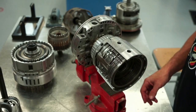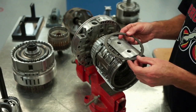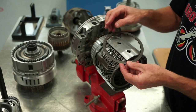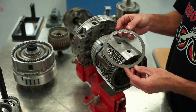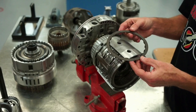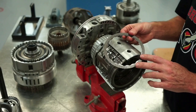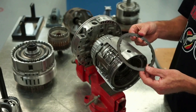The material that most clutches are made out of is a cardboard or paper type — a cellulose type material — with different compounds in it. What makes them look different are the different compounds, which are specific to the transmission and to the type of fluid that transmission uses. That's the reason it's important to use the proper fluid with whatever transmission you've got, so the clutches are compatible.